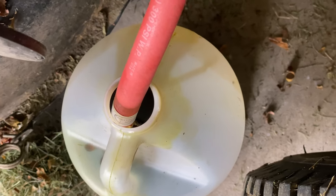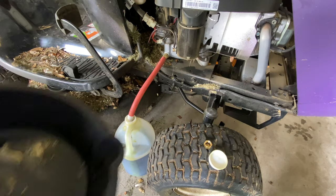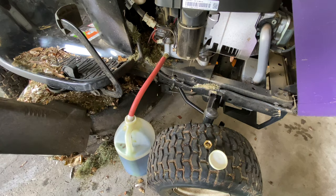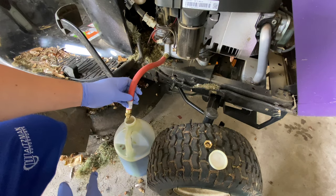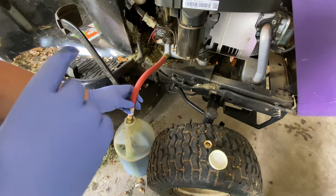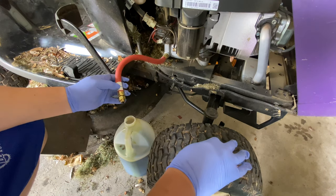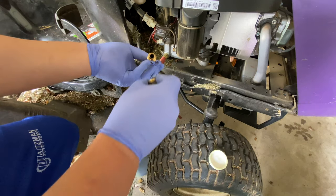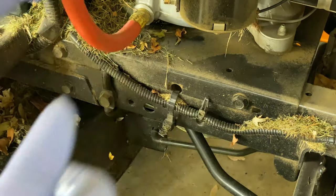I've let this drain here. I got the pan out because I was going to show it to you, but it drained out quickly enough that there wasn't much by the time I got that pan. You can see it's maybe dribbling just a little bit there. I kind of just put a couple ounces of oil into the crankcase just to flush out what was remaining. But it's that simple. The fact that this video is so simple should be a testament to how easy this makes changing the oil in some of these little small motors, because they can be kind of a pain.